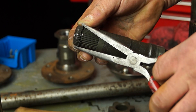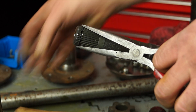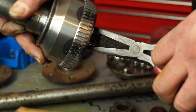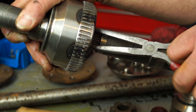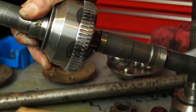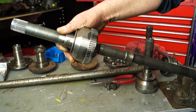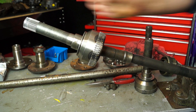So if you just missed that, it's a matter of squeezing this up. Some people use a cable tie. Get the CV and slip it till it's butted up with the clip so it's holding it in place, making sure that it's squeezed up. Holding it in place and — whack — straight, that goes on. So it's as easy as that.